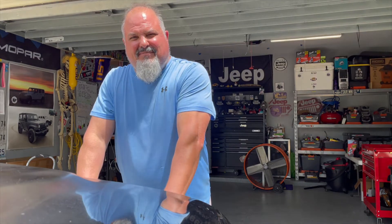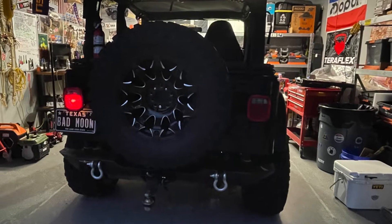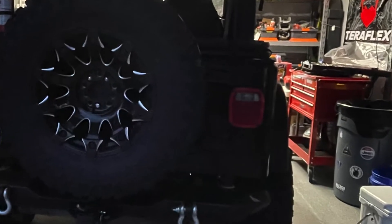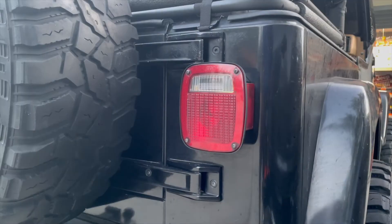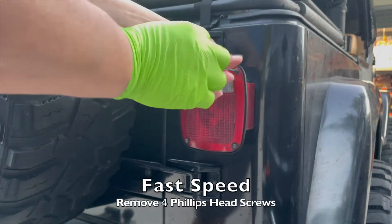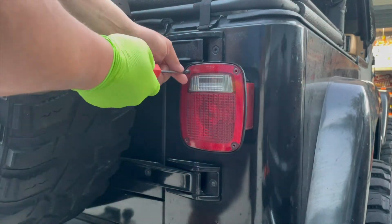Thank you for watching. So even though a brake light bulb and the tail light bulb is the same bulb, on this example the lights are on and the passenger side bulb is out. So we're going to access it. You're going to need a Phillips screwdriver — there's four screws. We're going to put this on fast speed and remove the outside lens cover.